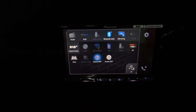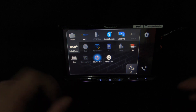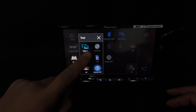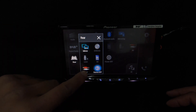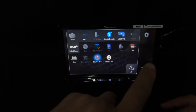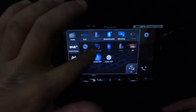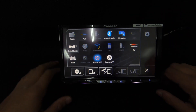Camera view: when a camera is plugged in and connected to ignition power you can press that to view the camera while driving or at any time. Under the AV section we have USB mirroring — this controls what you want to output to the rear video RCA, whether it's AV, SD, USB, CD, DVD, or mirroring your device. AV input and USB one and two are shown — anything not highlighted indicates nothing is connected. SD card is accessible by pressing eject and open, revealing the SD card input.